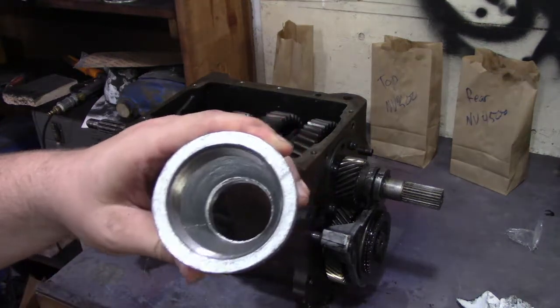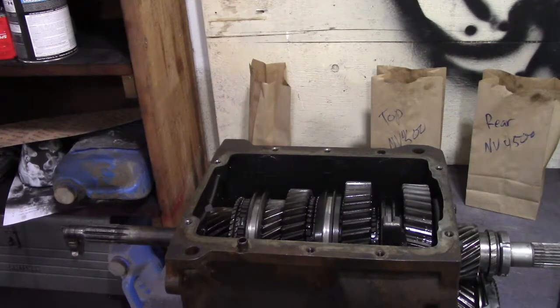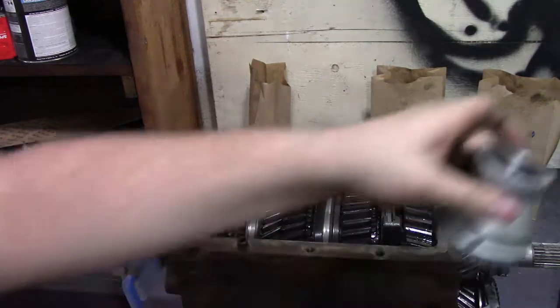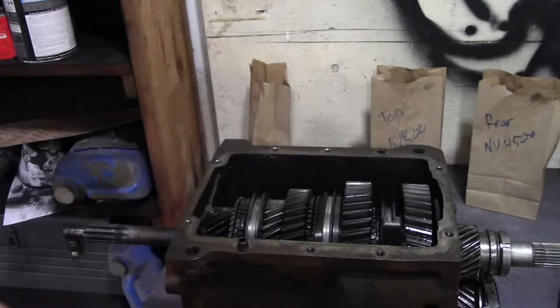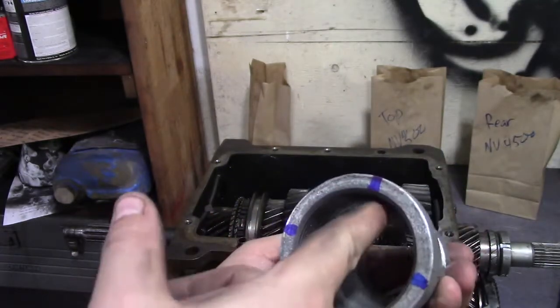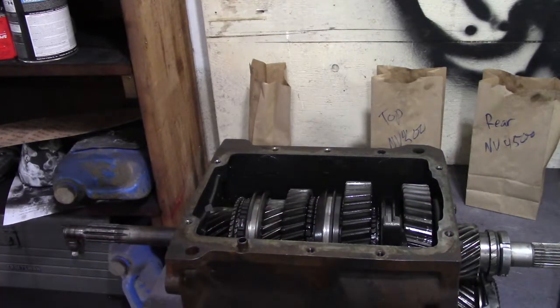So we're gonna remove the teeth here on the lathe and then put the 4 teeth in there, and hopefully everything will work. Alright, so I got the threads ground down enough so it sockets over. So that fits on quite nice there. Now we're just going to come through, and on these marks here, I'm just going to lay a bead of weld, and then with the file we'll just grind it down to the last section and we should be somewhere.